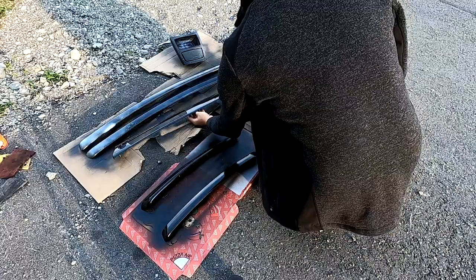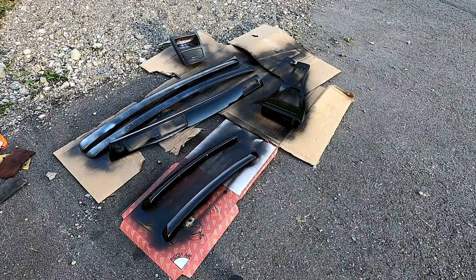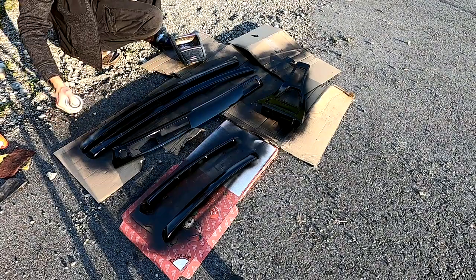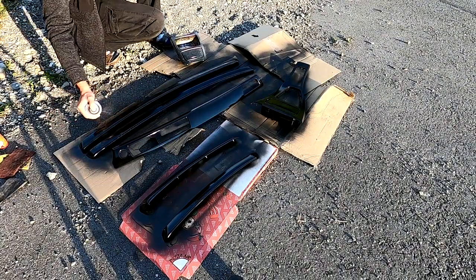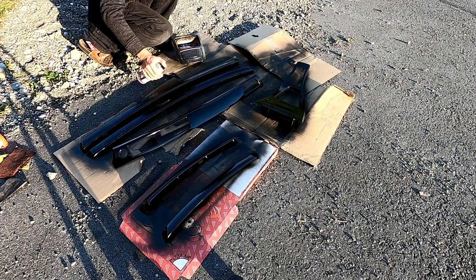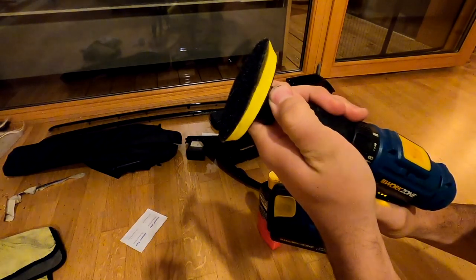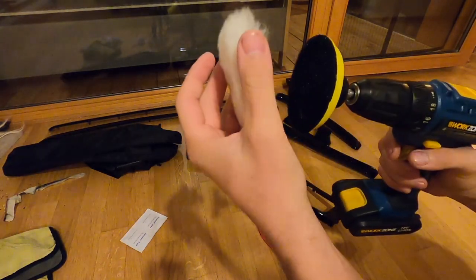Which was really annoying. I ended up grinding away nearly all of the paint, then spraying on some primer, wet sanding with some 400 grit sandpaper, followed by the gloss black again, and in the end applying some 2K clear coat. This turned out really really well and after 4-5 days of letting everything dry, I started polishing everything for a high-end finish.